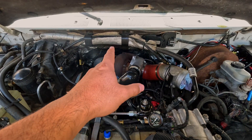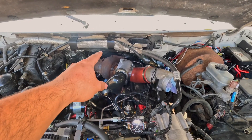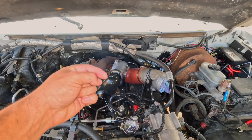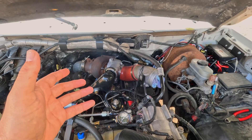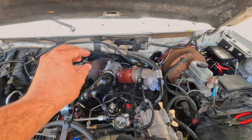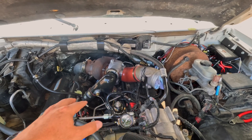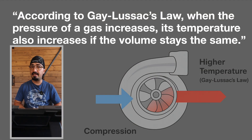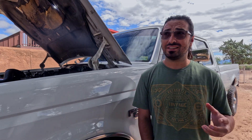As a quick review: your turbo has two turbines — one on the exhaust side and one on the intake side. As exhaust leaves the motor it spools the exhaust turbine, which transfers that motion to the intake side, sucking in air and creating boost. Unfortunately, a side effect is that heat from the exhaust side leaches onto the intake side, heating the air going into the combustion chamber. Gas law also states that if a gas is pressurized while volume stays the same, temperature increases — which is why temperatures rise so dramatically after a turbo compresses the air. I want to know if the cold air intake design can affect this temperature, thus impacting performance.